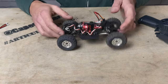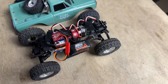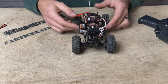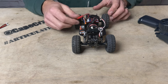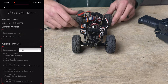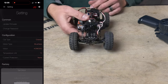Here's my setup. I've stuck the Python RXF on the back and I've got my battery on the side. Alternatively, I might put the Python on the driver's side slider and the battery on the right just to even things out. I went into the FuryCar app, got everything up and running, did some minor tuning with the drag brake and punch, made sure the firmware was up to date, and turned up the voltage on the servo — so we should be ready to rock and roll.